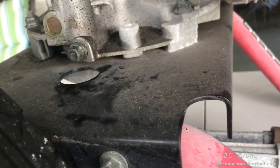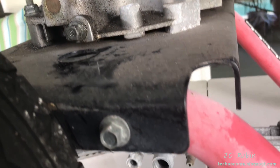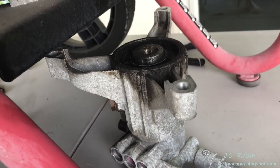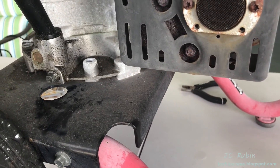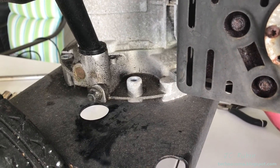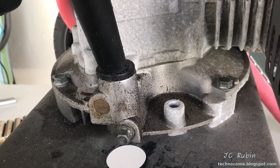With that, I will remove the pump from the unit. The same bolts that hold in the pump also hold in the engine, so great care must be taken as the engine could fall off. So long as you're on a flat surface, three bolts will drop that pump right out the bottom. It just falls right down onto the table and I slide it out from under. I'm going to take a couple of bolts and run them through here just so the engine doesn't fall off the platform. I put two of those bolts back in — that's a lot safer than having it completely decoupled.